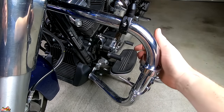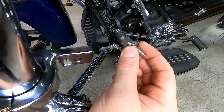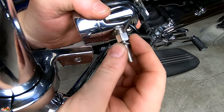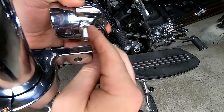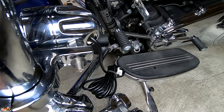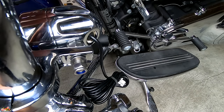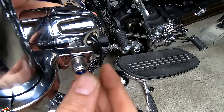Now I'm going to show you putting the light in. The Halo Lighting Kit comes with a mounting stud, two washers, and a half-inch nut. You take your light, find the hole on the side, screw in the mounting stud, put it through the hole in the clamp, add your second washer, and use a half-inch socket to tighten down the locking nut. Make sure as you're tightening it, you get it pretty level — tip the bike up to check, because the last thing you want is the light aiming down or too far up.